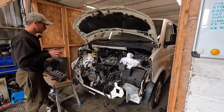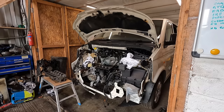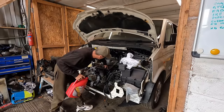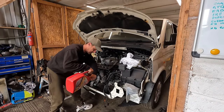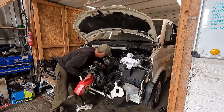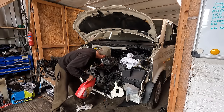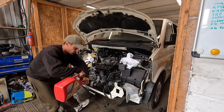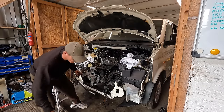Anyway, we're ready. I just wanna put a bit of oil in the bores, bolt the head down, one moment. I am keen to get this running. So, little dribble of oil just in the cylinders. It may smoke a tiny bit when you first start it, but I'd rather that than it take 20,000 miles off in the first 10 seconds of running. Because obviously it's bone dry until oil pressure's built up. And even if you wang it over with, say, the crank sensor unplugged, the pistons are still ferociously going up and down. Right, that is done, we're ready.